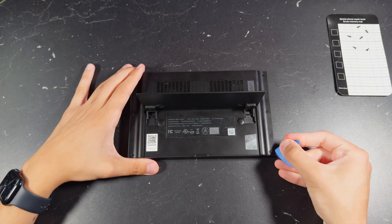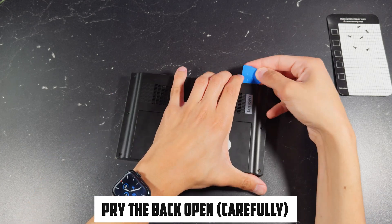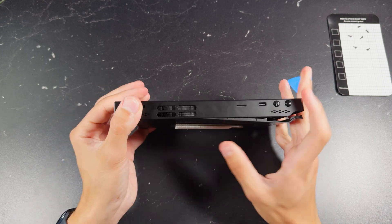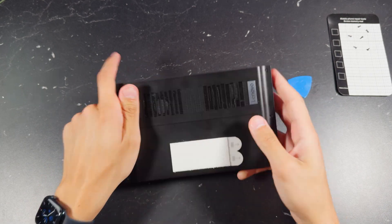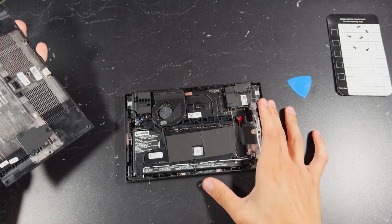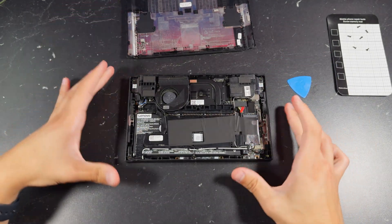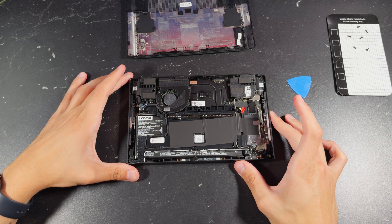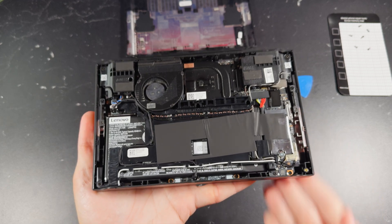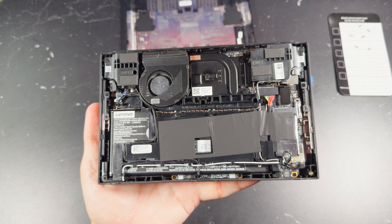Go ahead and grab your pick or pry tool and start prying out the back of the device very carefully. It is easiest to start from the top corners, but it might also be helpful to lift the kickstand up a little bit. Be careful not to turn on your device, and if you do, just hold the power button down until it shuts down again. Once you get the back plate off, you should see the inside of your Legion Go. It may be pretty dusty in there, so give it a good clean and blow off some of the dust. We'll be mainly focusing on the bottom right-hand side of the device — the SSD is the tiny thing wrapped up in the bottom right corner, held by one screw.